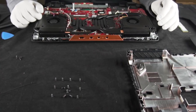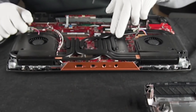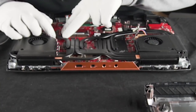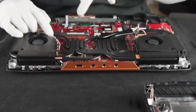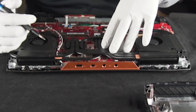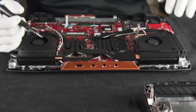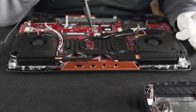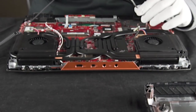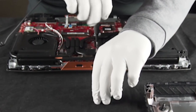If you look at the heat sinks themselves, you'll see that they're numbered: one, two, three, four — then over here five, six, seven, eight. This is your GPU, and this is your CPU — you can tell because there's a much more robust cooling solution on this side, covering all your memory chips. Follow the numbers either direction whether you're taking it on or off. It will help when you're putting it on to spread the paste evenly. Definitely keep all these screws together.